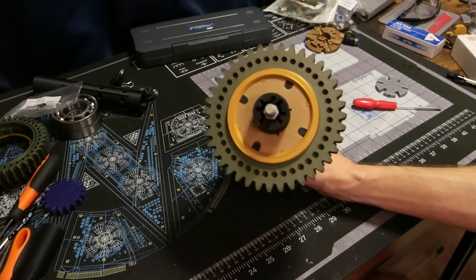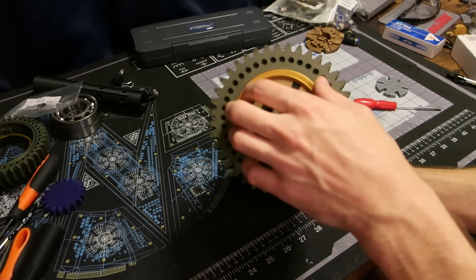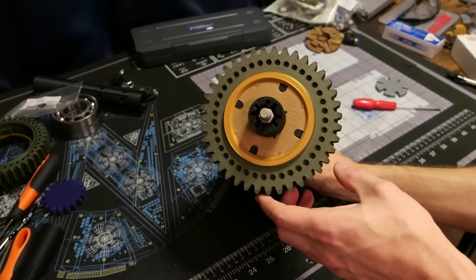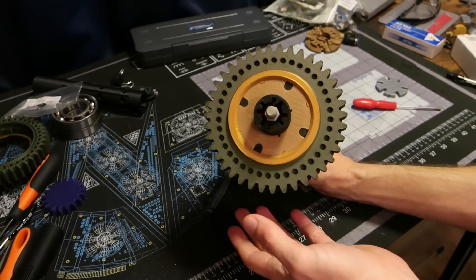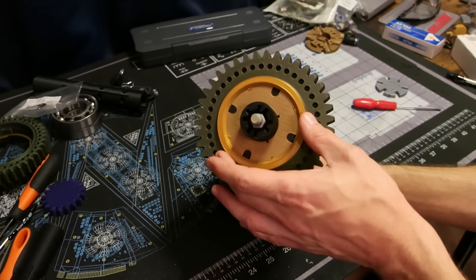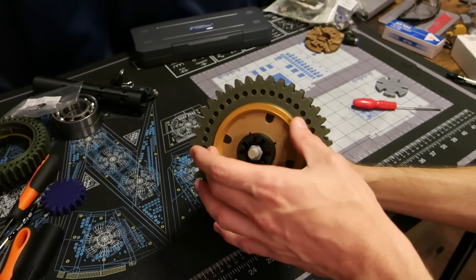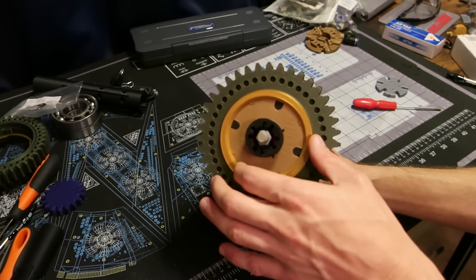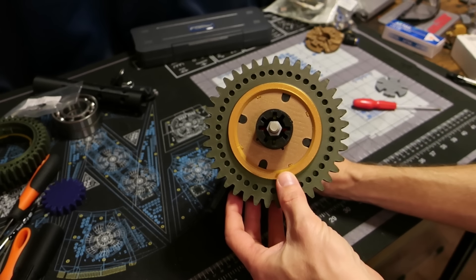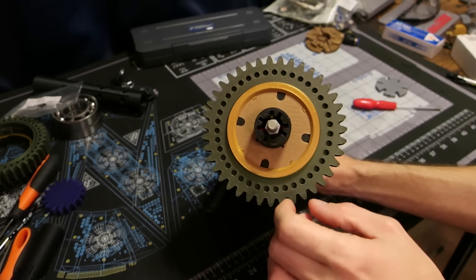Within the engagement holder mechanism you'll see there are four lever pins, control levers, shift pins — a lot going on inside. The bronze-looking piece represents the bearing — there are two sets of bearings per gear — allowing these gears to freewheel independently from the countershaft whenever we're not using that gear. From the patent drawings it looks like they use a plain-type bronze bearing. I don't believe they actually use any rollers on this. I'm going off what I have in the patent, and this seems like more of an engine plain bearing where they rely on oil to create a lubricating film so there's no metal-to-metal contact.